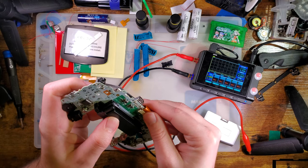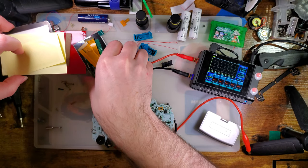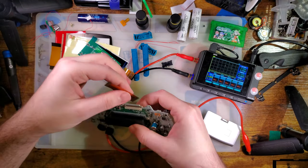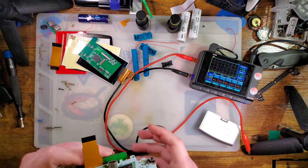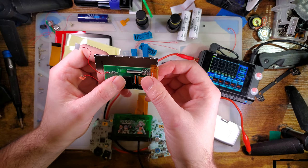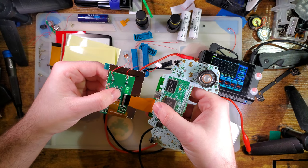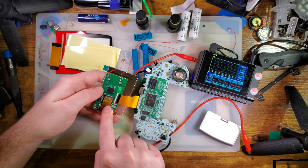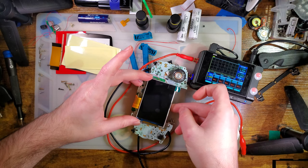Anyway, let's test out the new kit so we know it works before we go through the effort of installing it. And I've got a 40-pin GBA, which means I need the 40-pin cable. Plug that in on the mod PCB board side, PCB side. Both the ribbon cables go pins down. On the GBA side, the ribbon cable goes pins up. And then it just goes like that.